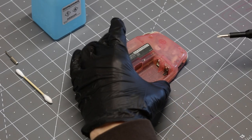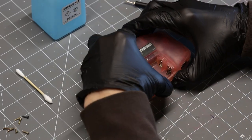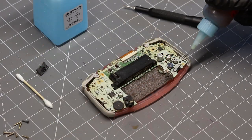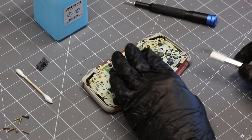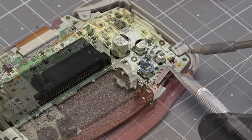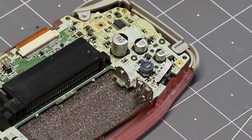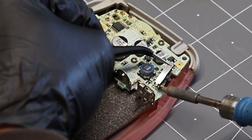Let's start by disassembling your Game Boy and unscrewing the seven screws on the back of the shell. Next, we're going to remove our plastic switch extension. Then, we're going to take some liquid flux, such as rosin, to help assist with the desoldering process. Place your razor knife under the top of the metal switch cover, slide the razor to the edge, and use a downward twisting motion while heating the solder pad. This will help keep the plastic down while pulling the switch cover off. With the right side raised, grab with the tweezers and remove the switch cover while heating the other soldering pad.